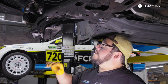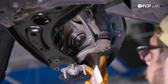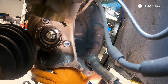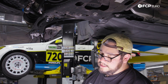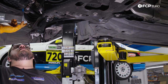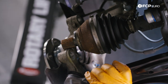Now I'm going to put a little bit of Liqui-Moly anti-seize compound on the threaded portion of the axle, then remove the ball joint stud from the control arm and feed the axle back in. I'll loosen the control arm now. Literally just putting a small dab — the most minimal amount. This isn't mandatory, but we live in New England and should this car ever see salt, this will keep it easy for the next person who does this job.